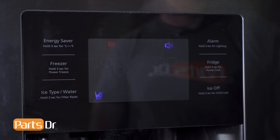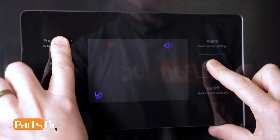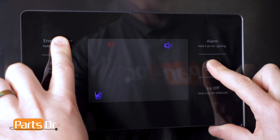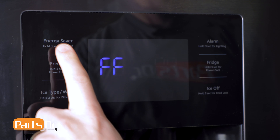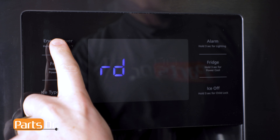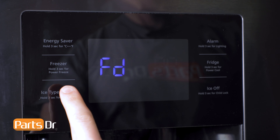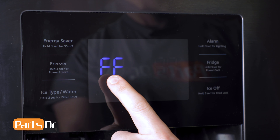The first thing that we'll need to do is put the refrigerator into a mode where the compressor should be running. On this refrigerator, we're going to put it into a forced function mode by pressing and holding these two buttons and then selecting the FF option from the menu. While the refrigerator is in this mode, it will make this annoying beeping sound the entire time. The buttons used varies depending on each model refrigerator — drop a comment below with your model number and the button sequence used.